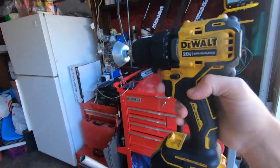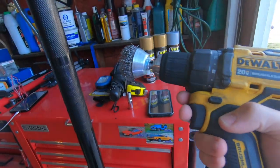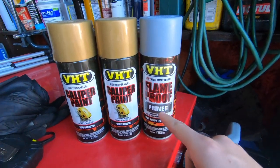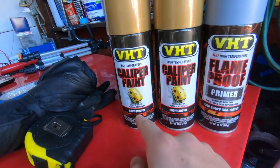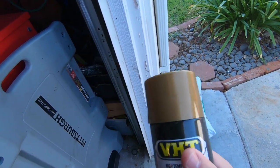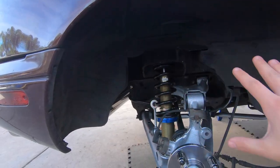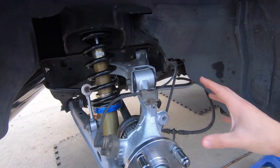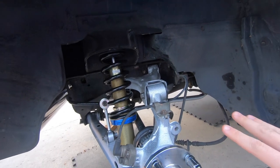Say hi, Lena. Hi guys! So obviously, like you've seen in most of our videos, you'll need a wire wheel on a drill or impact, some brake cleaner and primer — flame proof up to 2000 degrees — and 900-degree caliper paint. We chose a gold; it will kind of look like this but you'll have to see it on the car. It's almost like a bronze, like the STI's brakes back in '07, the Hawkeyes. We're just going for a clean OEM-plus look on this build.